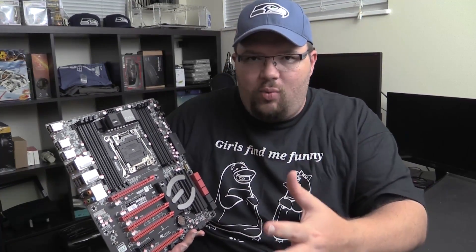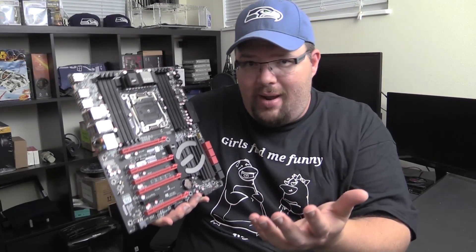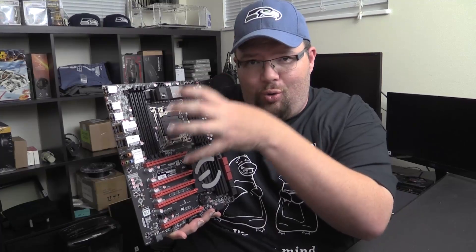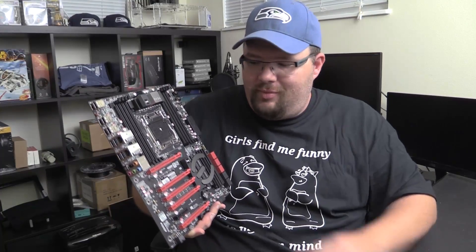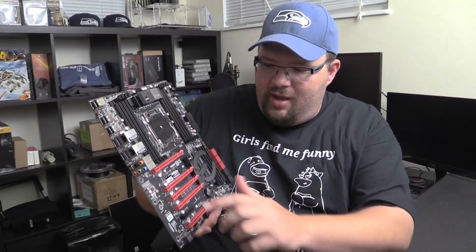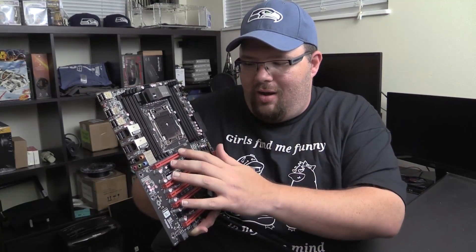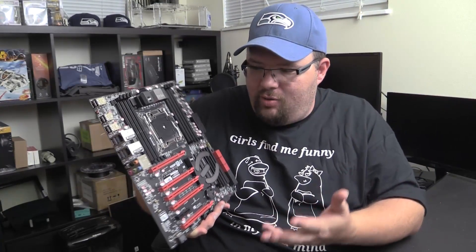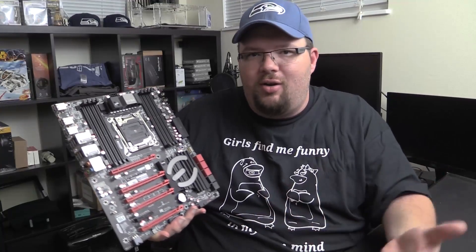The one thing I'd really still like to see is that EVGA insists on putting the top x16 slot all the way at the top. That's great until you put a really big cooler on, like the Be Quiet that I'm going to use, which isn't going to fit — it basically makes that top slot completely unusable. It would be really nice if they at least put a x1 slot there or something. You either need to give me more room around the socket or do something.